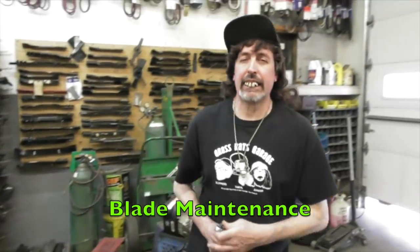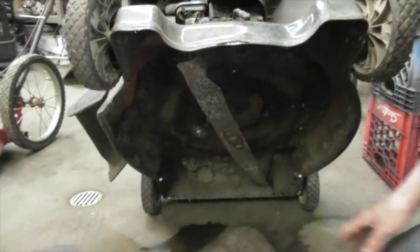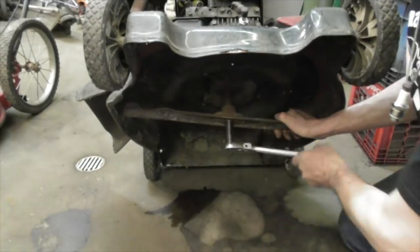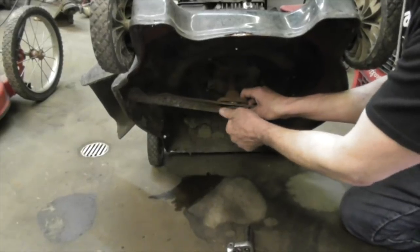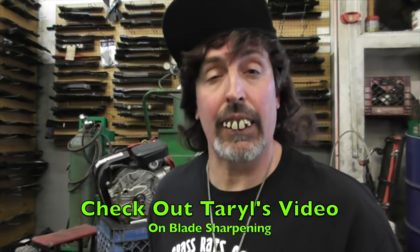Now we can go to the blade, dressing the blade. Most of these mowers got a blade hub. A lot of them just have one bolt in the middle. So what you can do is wear a glove, put a glove on. You can see I got a glove on. And then hold the blade, and then with a socket wrench, remove it. If you have an impact wrench, you can remove it with an impact. Take the blade off, and then sharpen it or have it sharpened. Or if you want to do it yourself, I have a video that shows you how to sharpen a lawnmower blade. So look on my channel on how to sharpen a lawnmower blade with Daryl.